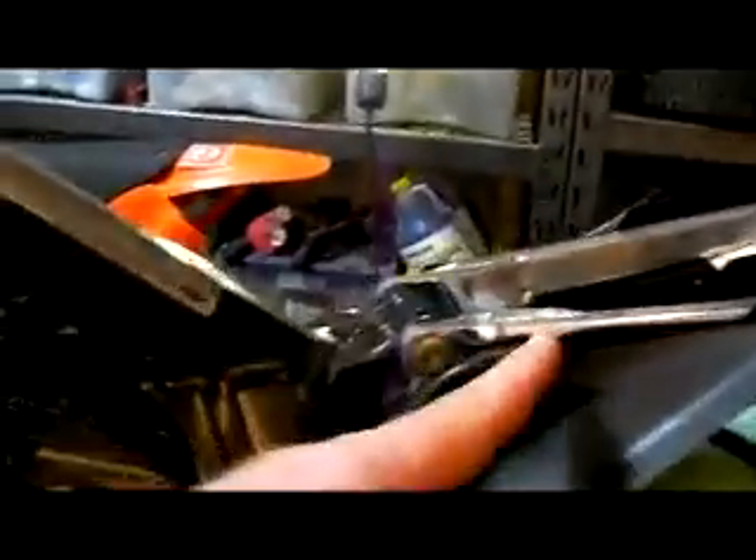I cut the zip tie and there are two hoses off of it. One says 'tank' and one says 'purge' — there's some writing on the panel. The one that says 'tank' goes through the frame, through the subframe right here underneath, and to this T right here. This hose here is the one that went up to the gas tank, to the top of the cap. One half of that T goes to the top of the cap, the other half goes through the frame over into the evap canister, and I'm about to pull the evap canister out.